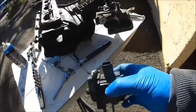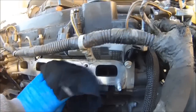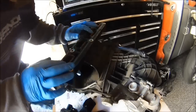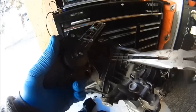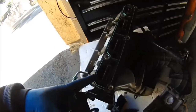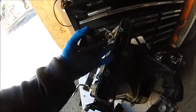This may be the problem right here — the intake manifold runner position sensor. I did a thorough inspection of the runners and the issue is not inside the runners. The issue is in here. Right here we are stuck — this is the stuck open position. This is spring-loaded and it springs right back. When the car first starts, these should be in the closed position, but on this vehicle they're stuck in the open position. They're only supposed to open when they reach a certain RPM, but they never close at all. So they're always stuck open — that's what's causing the lean condition and the fuel trims to be high.